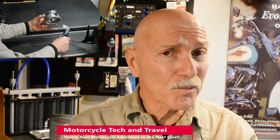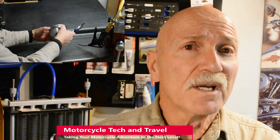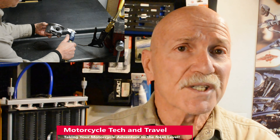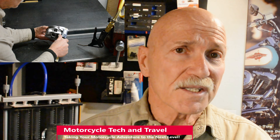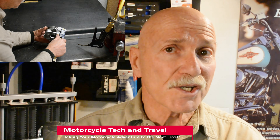The piston rings, however, are much thinner than the 327 V8 rings. These worn Honda rings are in the 1.25 millimeter to 2 millimeter thickness range. Thin steel rings like this are now popular for performance automotive engines.